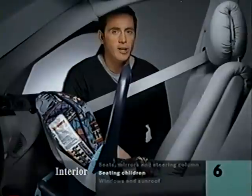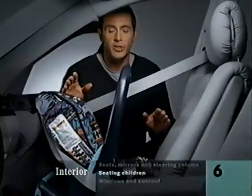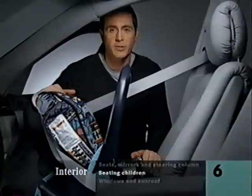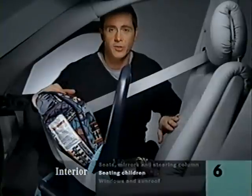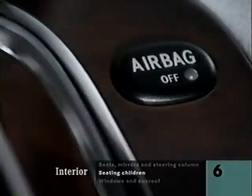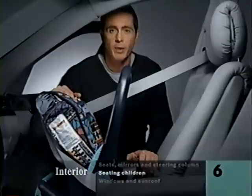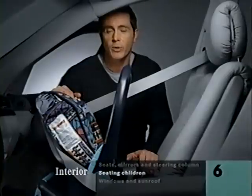Normally, children under the age of 12 should only sit in the back seat. However, there are Mercedes-Benz accessory child seats that can be used in front. These special BabySmart compatible seats contain a transponder that reflects a signal sent out by an antenna in the front passenger seat. This turns off the front passenger's front airbag. When it's detected, this yellow warning light comes on. You have to be careful to install this seat properly and only use a BabySmart compatible seat. There's also a switch on the driver's door panel that prevents kids from playing with the rear windows.